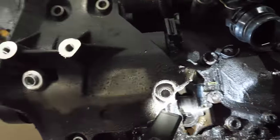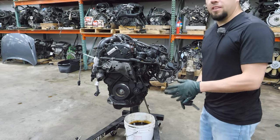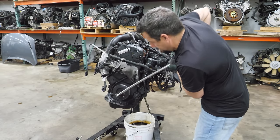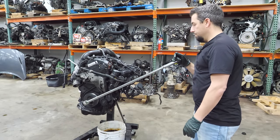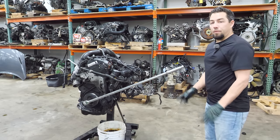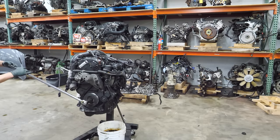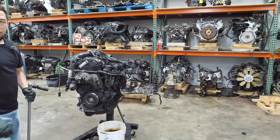There's a wrist pin just hanging out for future use. Clearly the next thing I need to do is see if the engine turns over. I will say this engine came to an abrupt stop, but that doesn't mean the engine's locked up. We just need a bigger bar — that's all this'll do it. After trying progressively larger tools and going both directions, it turns out we loosened the crank bolt but the engine is indeed locked up.